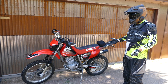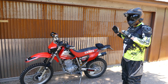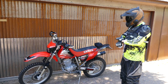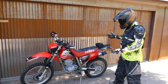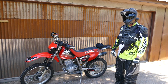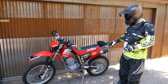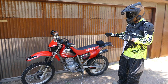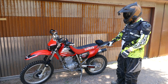I also have an XR 400 at home — it's not hard to kickstart either for the exact same reasons, and it uses the exact same routine. So first we're gonna do a cold kickstart, then a hot kickstart, then a flooded kickstart. For a cold start, any bike really should need full choke. If you can start the bike easily without full choke, it's too rich. If it starts really hard with full choke on, it could be too lean — so you've got to get your carburetor jetted right.